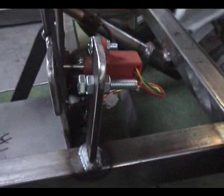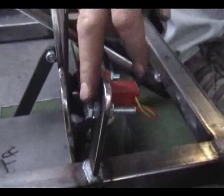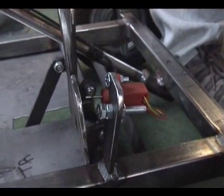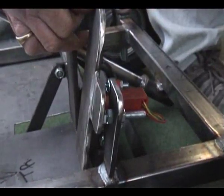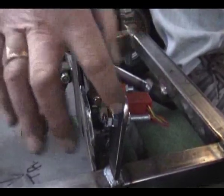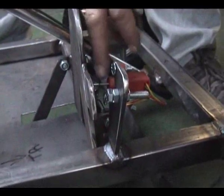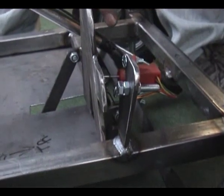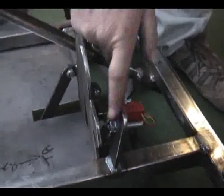We also have a throttle stop here which is adjustable. You can wind the cart right back to 2 miles an hour for somebody who is only just starting, so that the throttle pedal will literally only go to that point. Or for somebody more experienced you can open it up to its fullest potential. The adjuster must be set so the throttle pedal does not go too far and push the plunger out of the back of the plastic potentiometer housing — that must be set, very important.